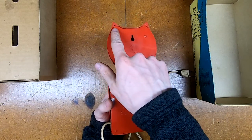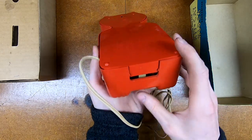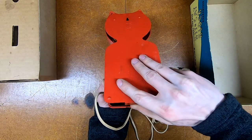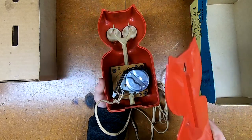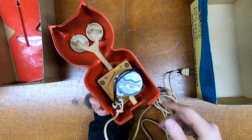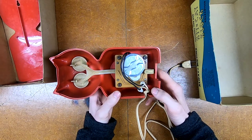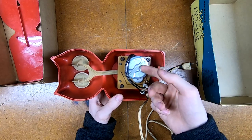The other bigger issue is it does not run. This little guy, like a lot of clocks from the period, relies on a synchronous self-starting electric motor. I actually have one in an Admiral radio and television sign from the same period with the same issue - it will not run. The coil seems to be good but the motor itself will not actually spin up. I don't have a lot of prior experience with these but we'll get inside real quick. Interesting construction - there are no screws. The ears up here have two tabs that hook in, and you push down on the tab at the bottom to unlatch it.